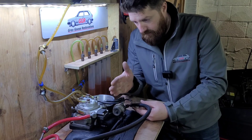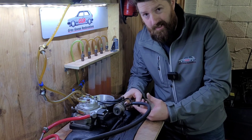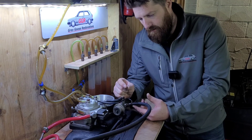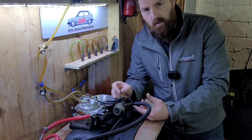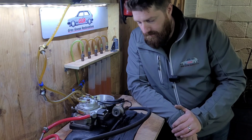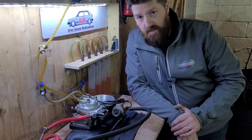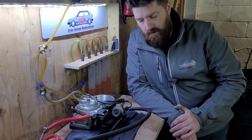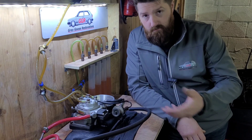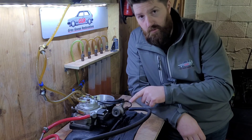To adjust system pressure: this is your return line off the back of your metering head. On the engine, take this off and inside the back is an Allen key. You screw it in or out — it doesn't move much, probably half a millimetre on the thread, but that small difference can make a lot. Screw it anti-clockwise to increase pressure, and clockwise to decrease pressure.